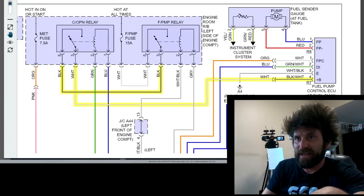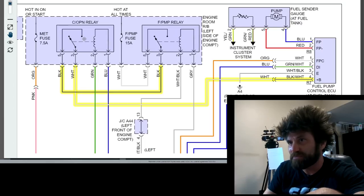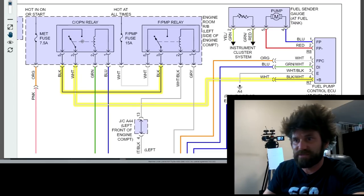It still doesn't exactly answer why this relay is open. My guess is it's because of the airbags being blown — I think when a certain number of bags deploy, this thing pops open and won't close unless I reset the airbag sensors. That's a step I don't feel I need to take if I can just jump it. I had a lot of people comment saying there's probably water in the tank, and I agree — but I also had Tundra owners say when you turn the key on you can hear the fuel pump right away. I can't hear mine, which is why I'm going directly to powering the fuel pump.